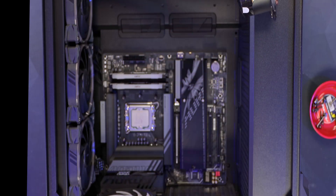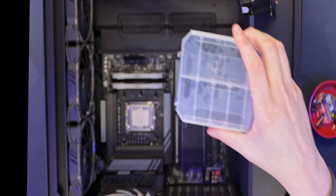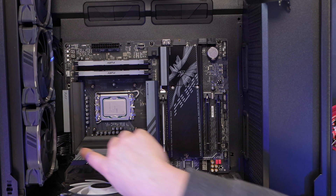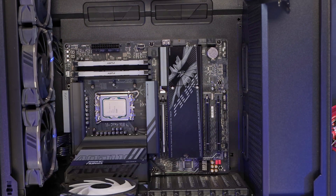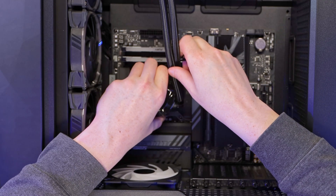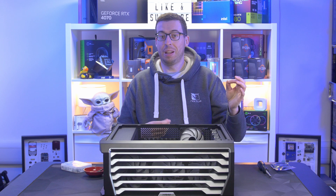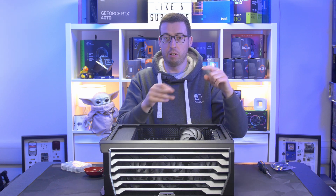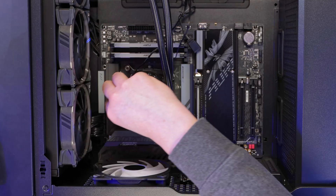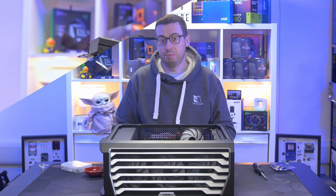There's a little notch that clicks in to hold the motherboard in position, so I get that screwed down. The case includes a nice little divided accessory tray. With the motherboard and EPS connectors all installed, I apply a line of thermal paste on the CPU — a line application since the IHS is longer. I mount the AIO pump with tubes at the bottom, tightening in a cross pattern — top-left, bottom-right, top-right, bottom-left — just like torquing a wheel, for even pressure across the IHS.